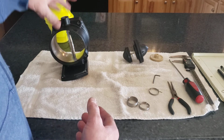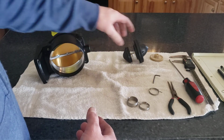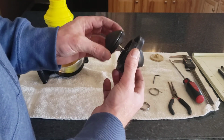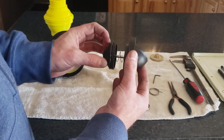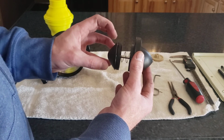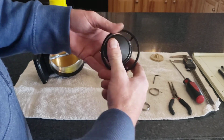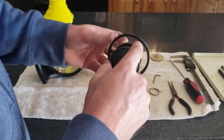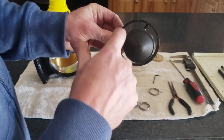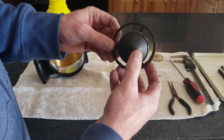And if this thing doesn't work out at the end of the day, I can always resort back to designing just a larger version of this, where it's a very light spring, a large valve face. I probably would end up with about a 3.5 inch diameter valve face and a 5 inch diameter body. That would allow this area here to provide minimal restriction once the valve pushes open.